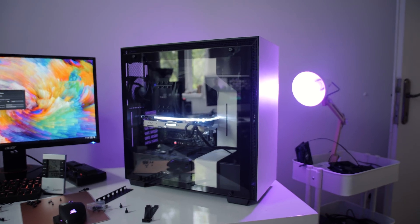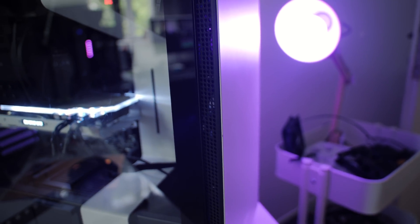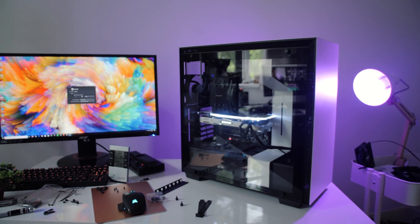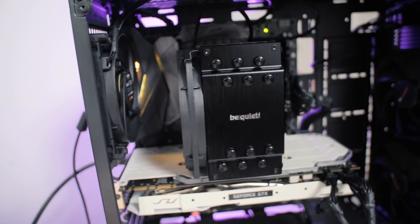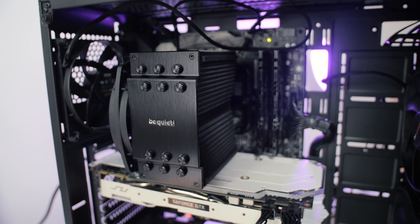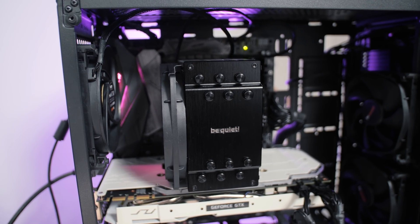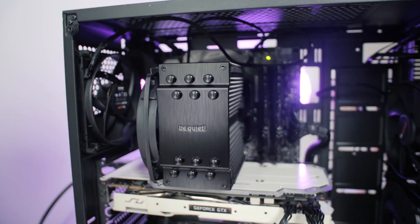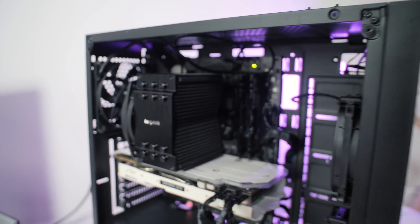I'm interested to see how that additional intake at the rear will provide cool air for the CPU. The first reverse airflow test is complete — I can feel a lot of heat coming from the side since that's the only way heat can escape at the front panel. The CPU and GPU temperatures are surprising, so I'll recreate that behavior inside the larger H700i. With the NZXT case assembled, I can feel more air being exhausted from the sides due to dual side ventilation. I also re-routed the CPU fan to push air through the heatsink for a fair static pressure comparison.